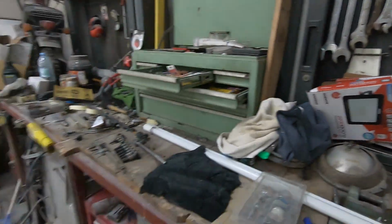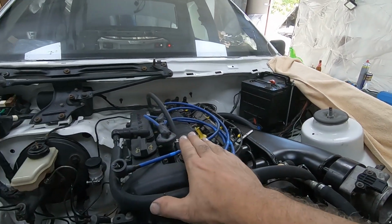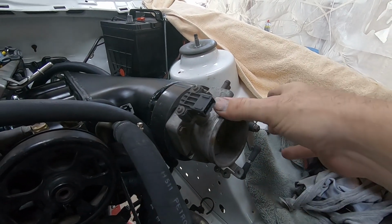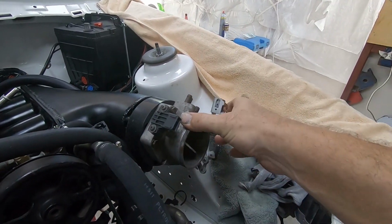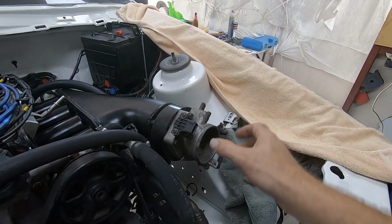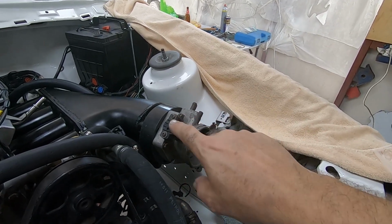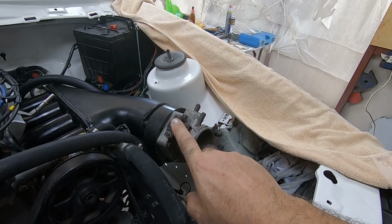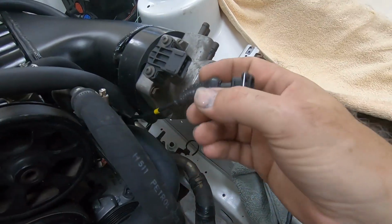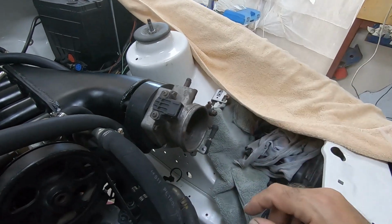So a little bit worried about the throttle body clearance here. I mean, that clears, and in theory that should clear, but I was just thinking if it doesn't, I've just attached a cable, and the cable can run through here, and we make some sort of bracket for it. Need to look at maybe turning the throttle position sensor the other way around, just so it'll be tidy for the wire. The wire's here, and it'll be tidier if it's stuck out the back. I think that's possible because you can calibrate these in the program on the ECU.